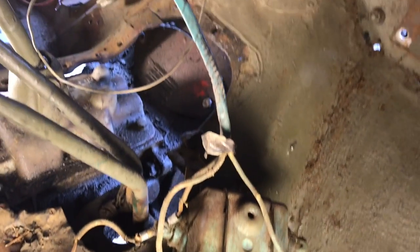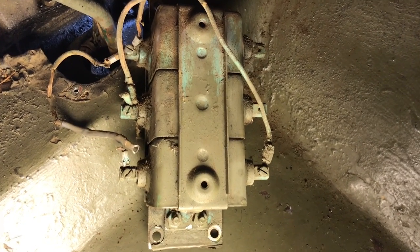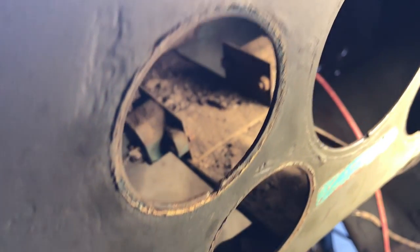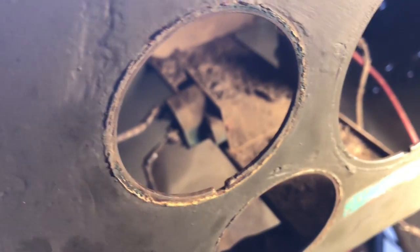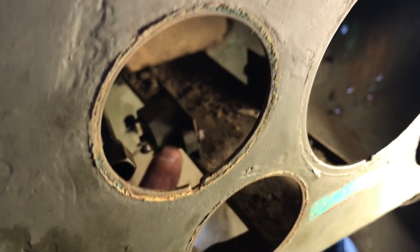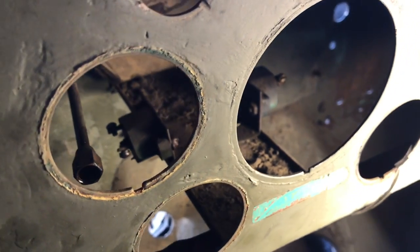With the filterette removed you can see those wires are attached to some of the other accessories — we'll talk about that when we actually rewire the Jeep. For now I'm removing each one of those leads, labeling them to the other end, and wrapping them up for the bag. Inside where the gauges were, through the holes in the dash, we can see two circuit breakers mounted on either side of the support running from the firewall to the dash. I'm systematically going through, labeling the wire ends to their respective locations, then removing them. The two circuit breakers are held in place with a nut and a slotted flat-head screw on the back side, so you need a screwdriver — a little tricky but that's how we remove both of those.